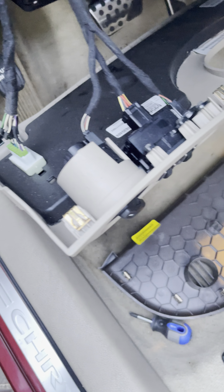So, you pull your dash. You got two screws on the side. It's literally that box right there. I just put it in, got to put the screw in it, snap it up, push it. Bluetooth works.